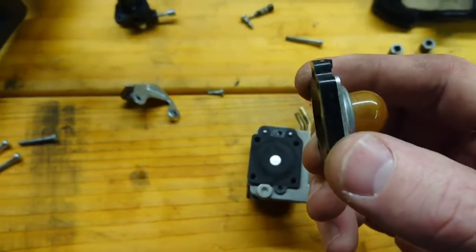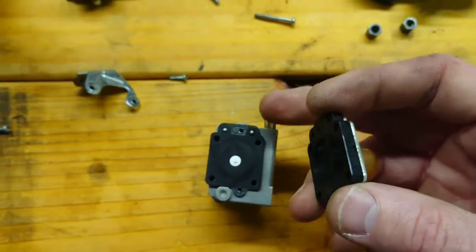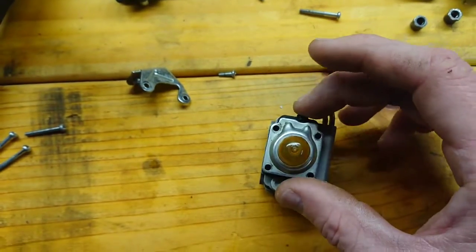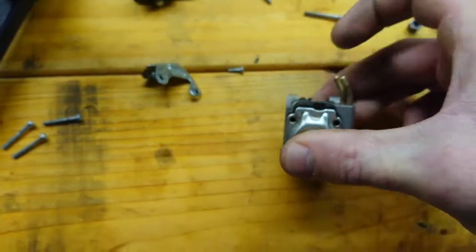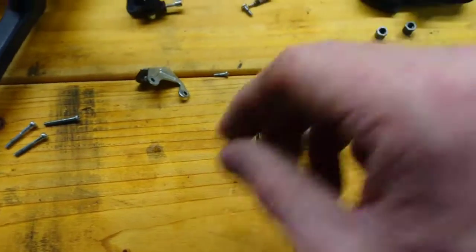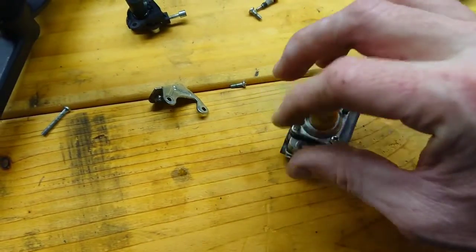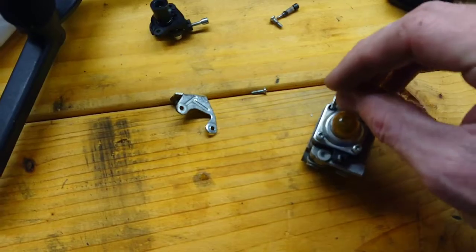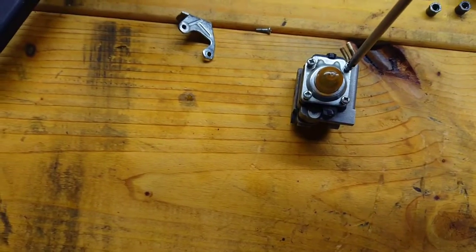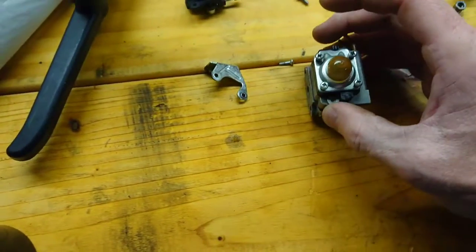And then you've got your priming body, and same again, that's also got its own alignment mark. So as long as these pins are going into these holes, you are in business. So once again, that's on the top there, and that should line the whole thing up as it's going through. Now easy peasy part. Now you just basically screw in all of them, and just standard stuff with torquing things up. Always do them diagonally, and with these screws you really don't have to tighten the hell out of them. They're essentially the gaskets and will do all the work. So let me just nip these up, and then I'll get back to you and we'll do the main jet side.